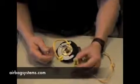If you'll notice on the bottom of this connector where it plugs into the harness, it's this funny looking spring right here that touches these two posts together. If you pull this in, you'll notice these posts won't be grounded together anymore.